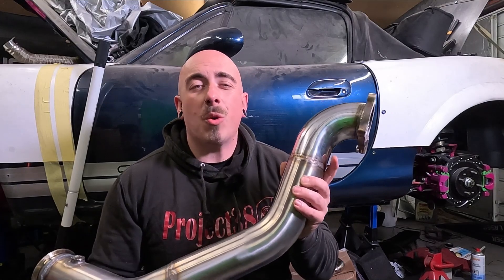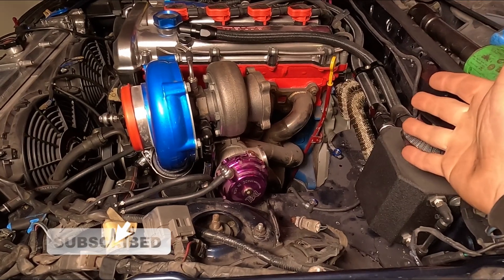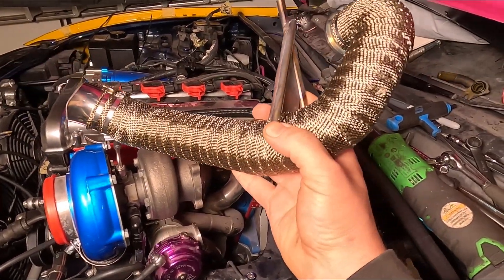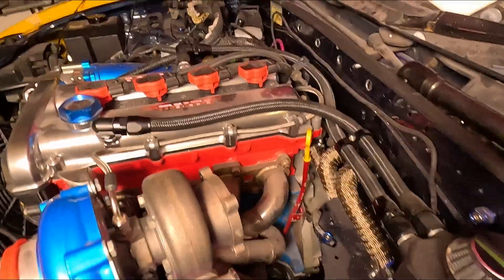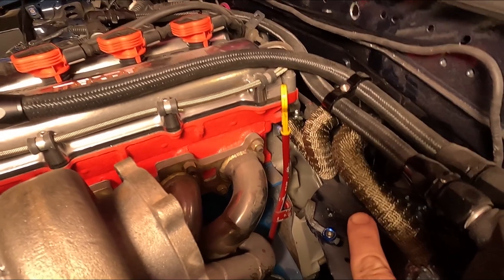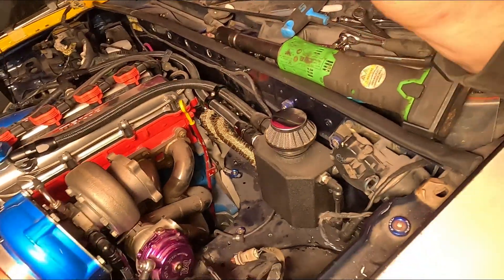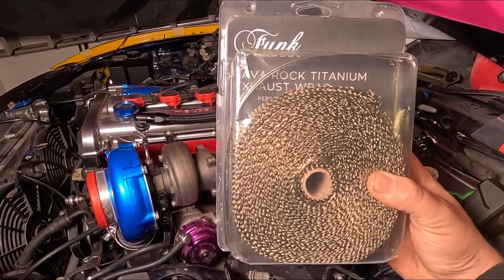But I think it's still not quite finished. In the area where the downpipe sits there are a few components I really don't want to get warm. The other day I tried out some Funk Motorsports heat wrapping on the screamer pipe and I think it turned out really well. I had some left over so I wrapped these two heater pipes here, so hopefully they're protected a little bit now. But I can't simply heat wrap everything in that area so I've got some more heat wrap to do the downpipe.